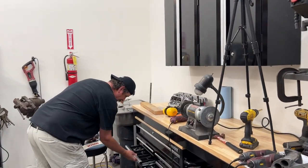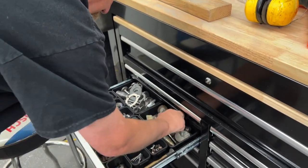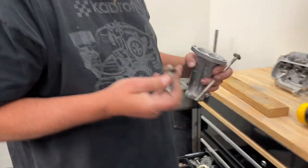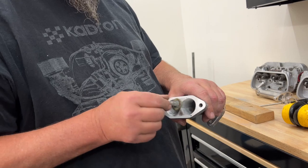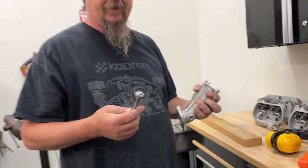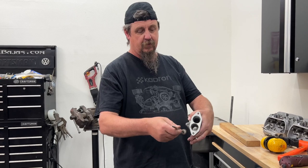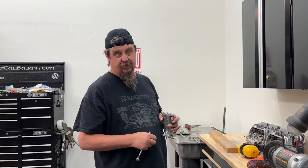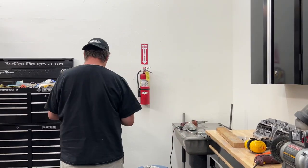Because if it condenses it turns into liquid, and liquid fuel doesn't burn well. So what we've got to do - we've actually got a couple of these - you take a really hard bristle brush, go through there, nail it real quick and put an etch in it. If we need to get further down in there, we have a longer one. This isn't a super high-tech intake manifold but it's certainly a lot better than stock. For the bigger 2-liter motors we'll enlarge all the way down through. This is for a 1679 - should make a lot better power than stock.